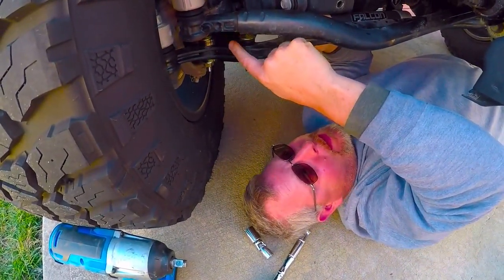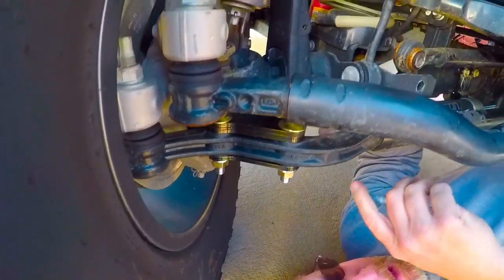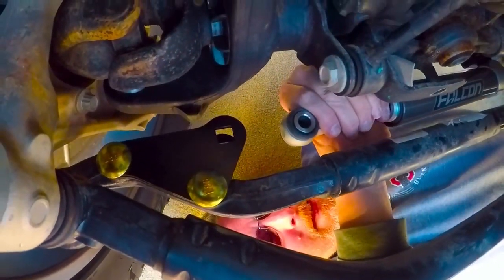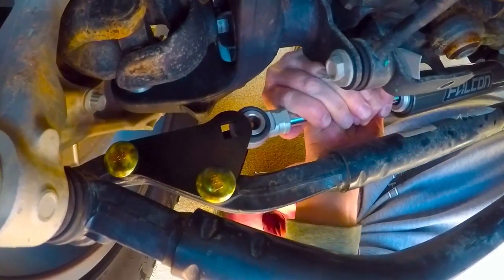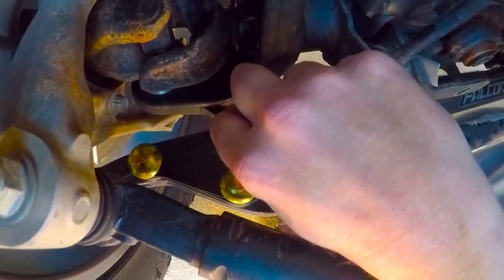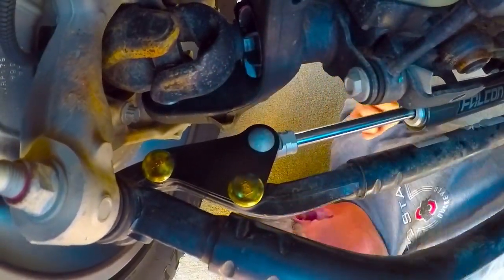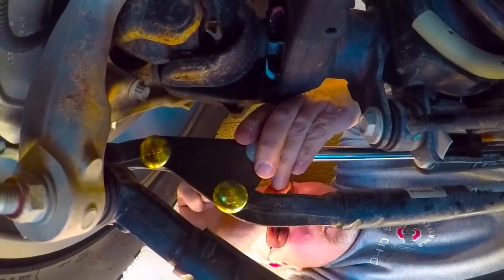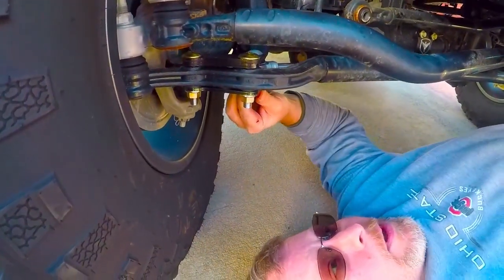So you see we got the bracket and the spacers on here. We got the bolts in, they're not tight. So the stabilizer itself, you really need to bear down on it to get it to collapse. Then you can see it's very, very tight. I actually collapsed it too far. You get in there with the bracket, and then you run your bolt through. That, and then put your nut back on, and this mod, this addition, this upgrade, is pretty much done.